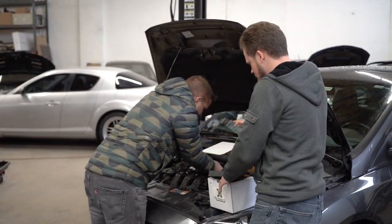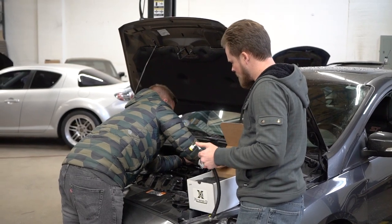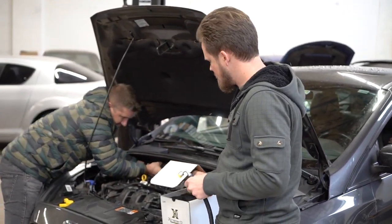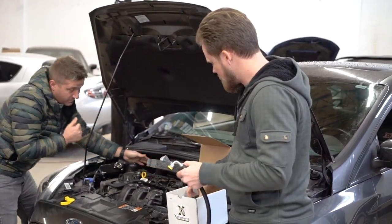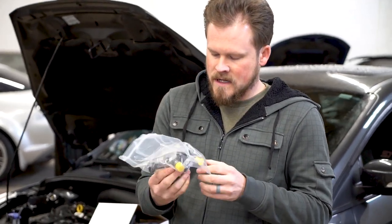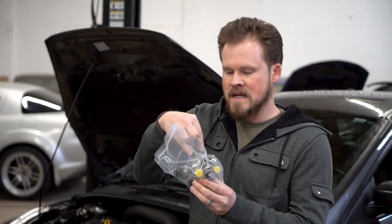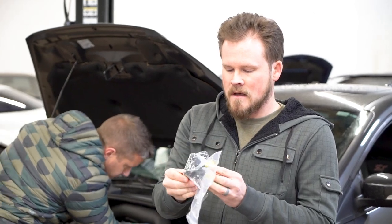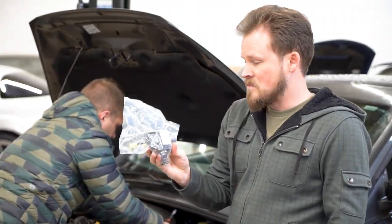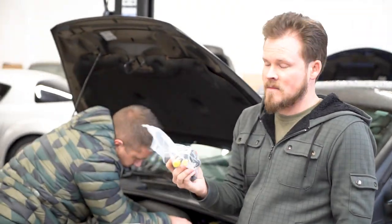While JP does manual labor, I'm going to show you guys what comes in the box. With this kit you get a new high pressure fuel line, some bolts — two bolts because the pump itself bolts to the flange and the flange bolts to the engine — and of course the pump itself. We've got the EVO pump here. When you're installing this, you have to orientate it because the flange goes on first. You bolt the flange down first, then you rotate it so the pump lines up, and then you bolt the pump down to the flange. It's a beautiful piece in the engine bay and it does plug in direct plug-and-play to the factory harness.